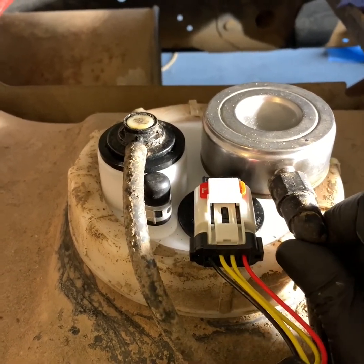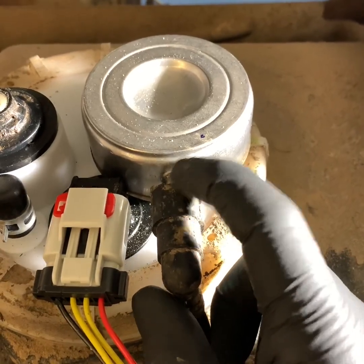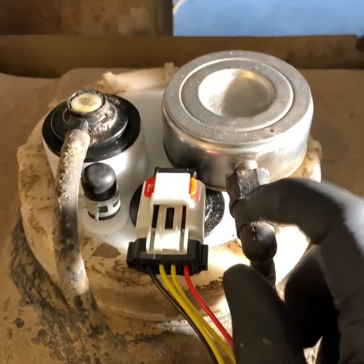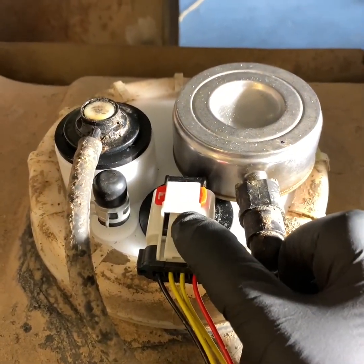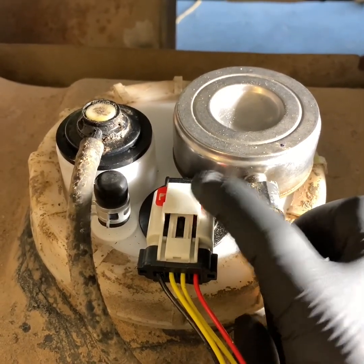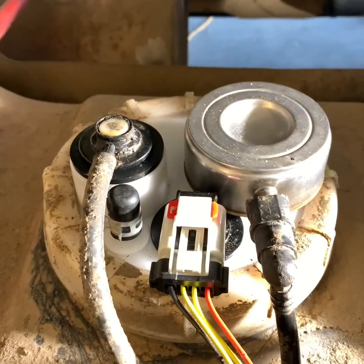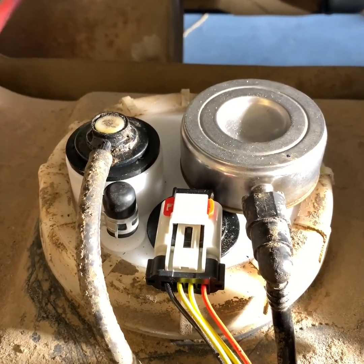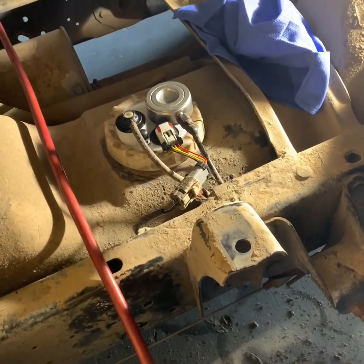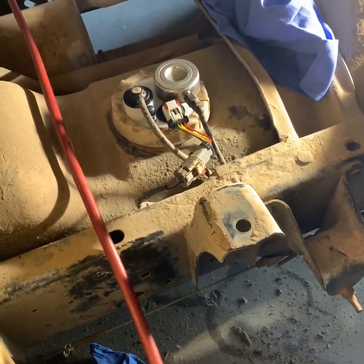And then I connected my fuel line. There's a plastic clip that you have to slide up on this nipple right here. It's real easy to do. Snaps this line in place, the pressure. Hook your electrical up. Lock this tab when you do that so that it'll stay connected to the pump. And then hook up your return line. And at that point you should be able to crank the engine up and check the operation of the pump. I've got the truck cranked up. It's running fine. So the installation of the fuel pump is done.